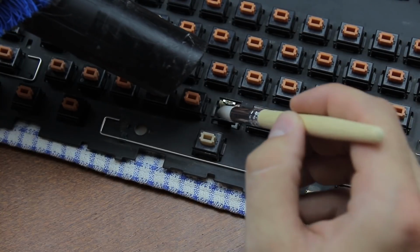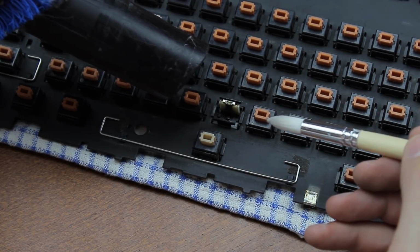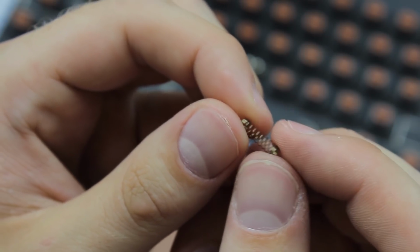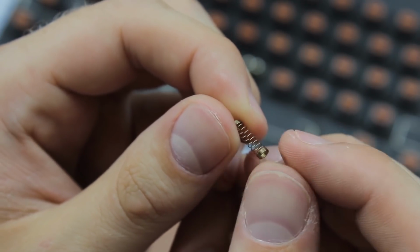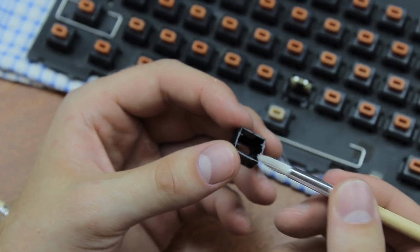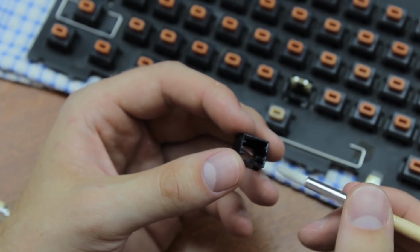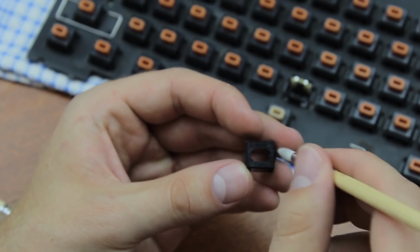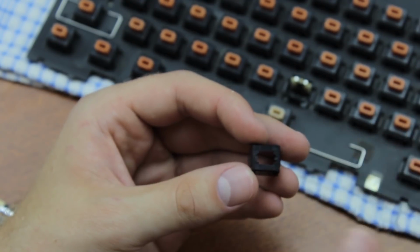Make sure you brush off the actuator too if it appears dirty. Blow into the spring to quickly get rid of any dust on it and gently stretch it to work loose any dirt. Then use a finer but still sharp brush to clean out the entirety of the inside of the housing, especially the tracks of the slider, and don't forget the slits on top as well, which are these things. Just brush everything off, including in all the many nooks and crannies.